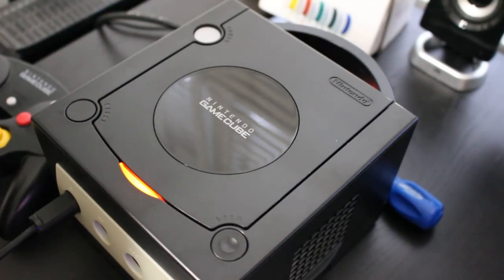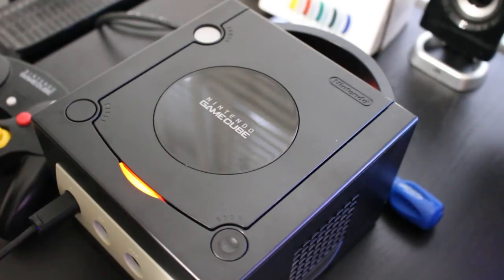So this GameCube I had to tweak down to 173.5 ohms. Again, before I touched it, this was about 660 ohms. I brought it down to 254, that was still clicking. I tried just over 200, as you all saw, and it was still clicking. But the number I got here is 173.5. That's why I highly, highly recommend using the multimeter for this, so you can get those precise tweaks and make sure you're within your safe limit.